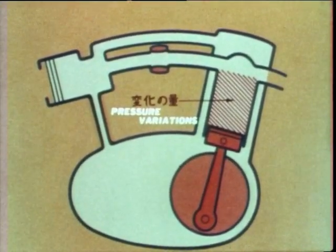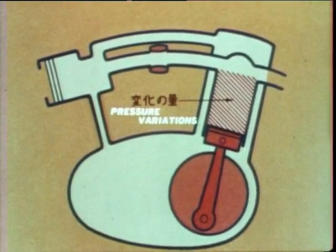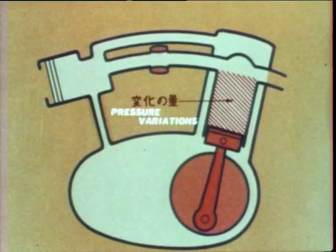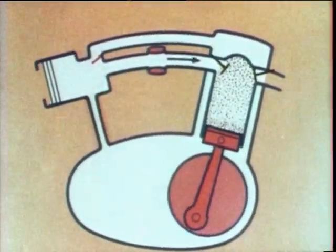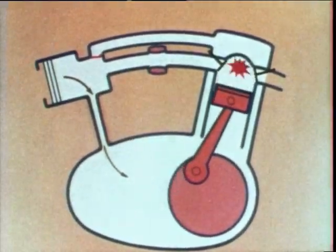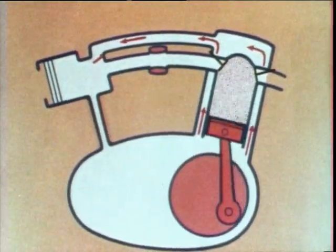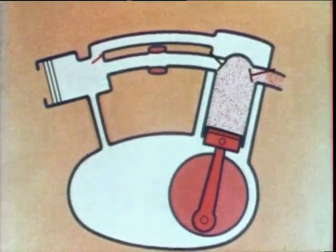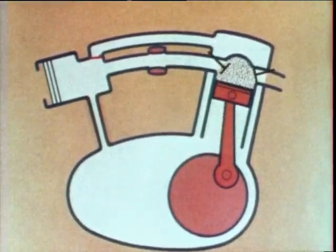The gases discharged from the crankcase contain blow-by gas leaking out between the piston rings and a cylinder wall. As the piston goes down, the reed valve in the air cleaner case opens and allows the blow-by gas into the air cleaner case. On the other hand, as the piston moves up, the reed valve closes and a fresh air-fuel mixture is drawn in from the intake manifold.